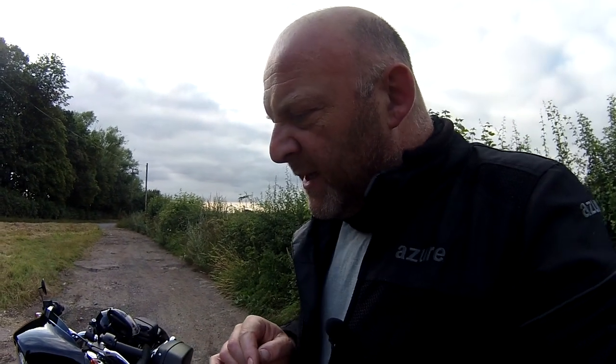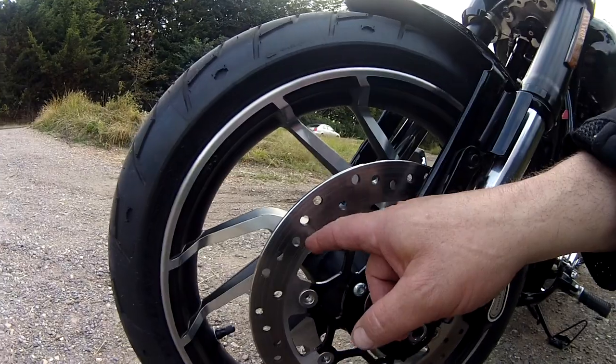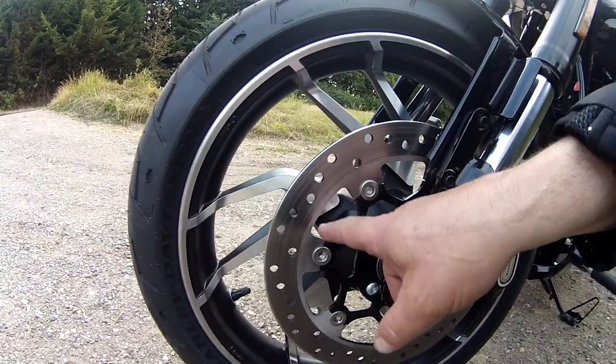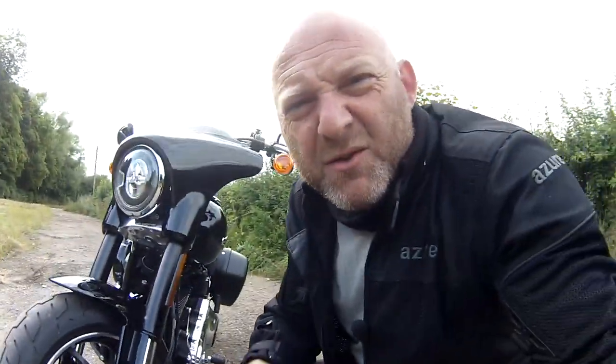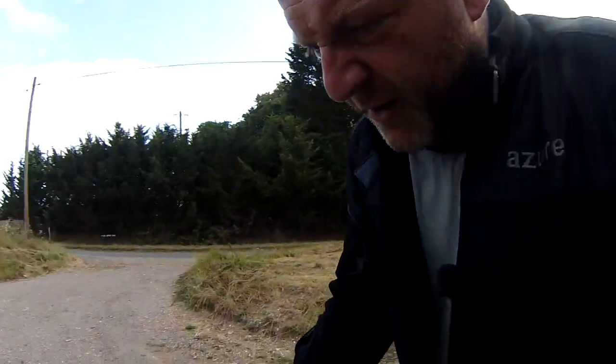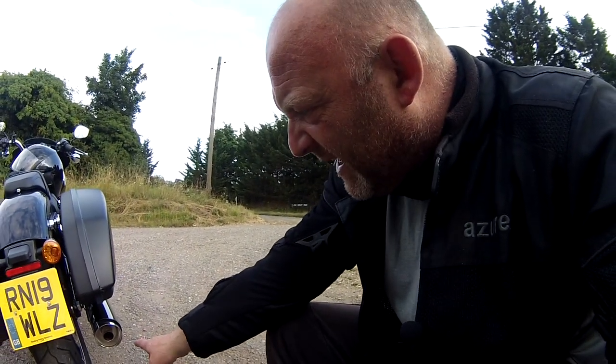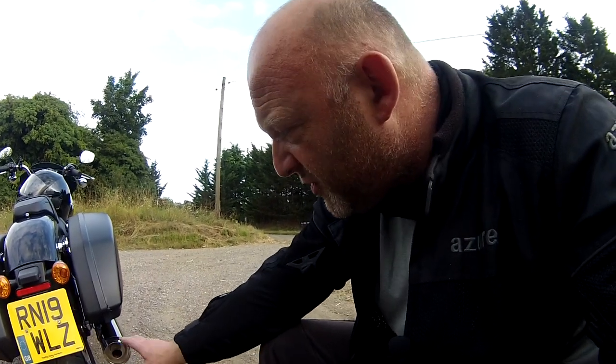I think what I'm gonna do is keep an eye on it. I've also ordered some brake caliper paint - instead of an aerosol which will go everywhere, I'm gonna paint the inside of the holes there. These edges here have also started to rust in places, so I'll give those a little paint with the caliper paint. I'm gonna check it out with the dealership before I do that, same with the rear disc.